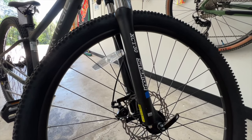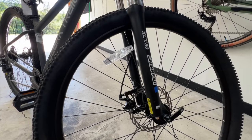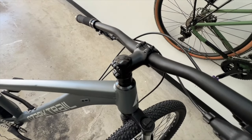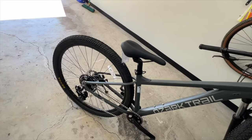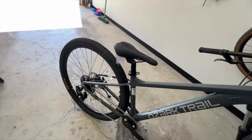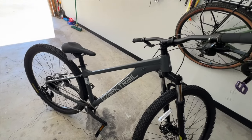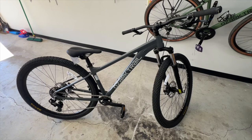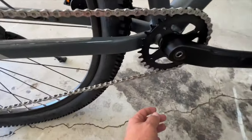You're probably getting the same fork, the Suntour XCT30 — probably an okay fork, but it's still a coil fork so it's going to be a little bit on the heavy side. You're getting that tapered head tube, standard 31.8 bars, and a seat post with a diameter of 30.9 — it's pretty chunky. We'll pull that out, put some grease on it, potentially cut it down a little bit to get it to slam down all the way. I do have some Shimano MT200s that I'll throw on here, and I will be doing those internally because if you've got internal cable routing, use it — it looks so sweet and it's not that hard to deal with. The biggest challenge will probably be coming through the chainstays.